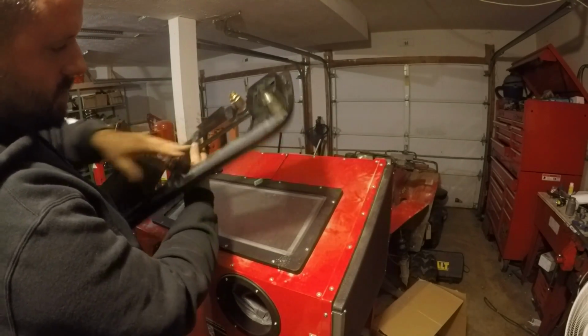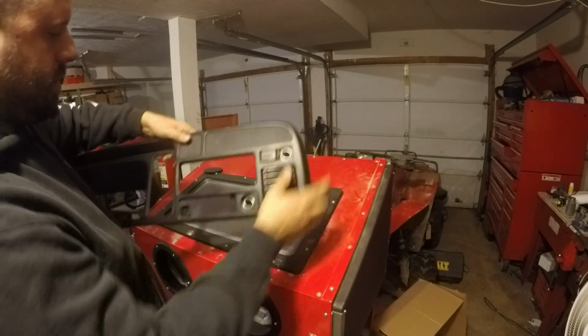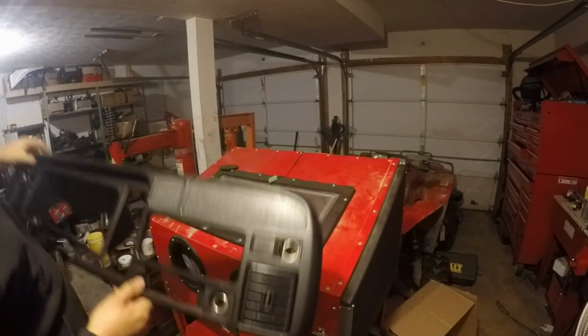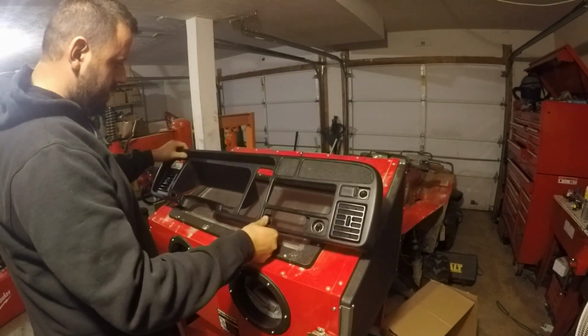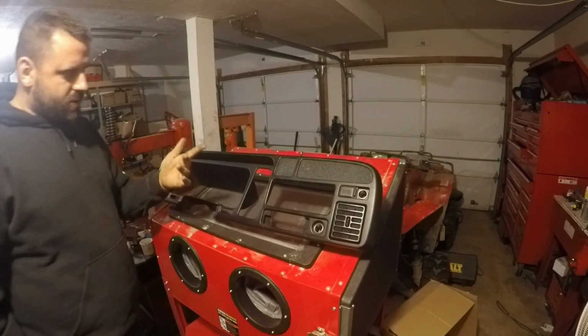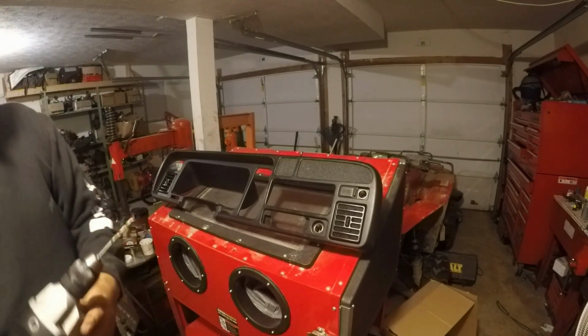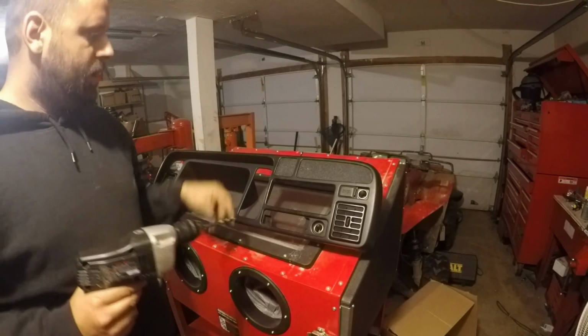All right, guys, my JB Weld's all cured up. Looks good, nice and strong. This is nice and solid. I think it looks pretty good. So I'm gonna go ahead and drill my holes here. I marked the center locations of where I want the holes at. I'm gonna go ahead and take this 1/4-inch drill bit and drill these out.